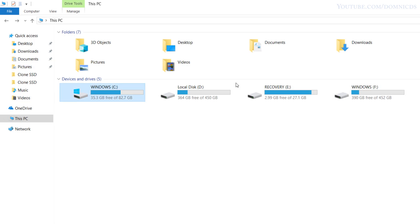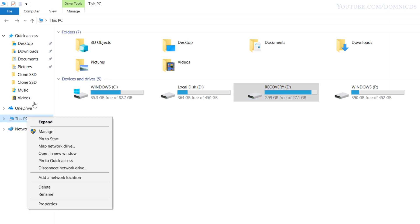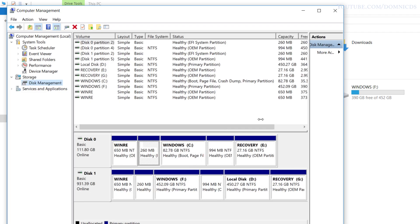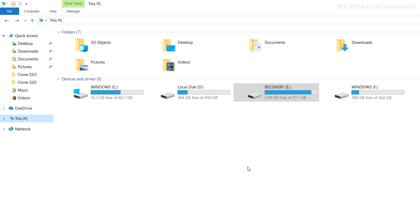I've switched the drives and I'm back. I will leave links in the description on how to open up the laptop and how to switch the drives. As I mentioned, the screen recording was messed up. The C drive is the SSD, the D drive is the hard drive, the E drive is the recovery for the SSD, and the F drive is the Windows files stored on the hard drive. You can either format your hard drive or leave it — I'm going to leave it since the first boot drive is set to the SSD. Disk 0 is the SSD and disk 1 is the hard drive in the DVD caddy.